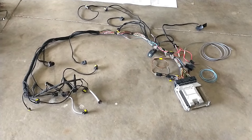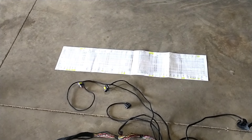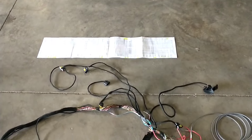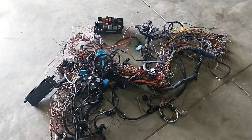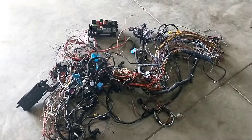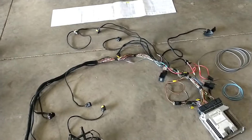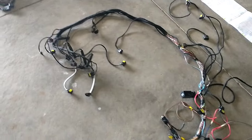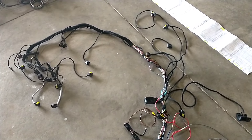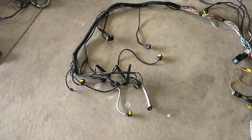I want to do an overview, but I really have to lay it out for you — you're going to have most of this junk right here and you're just going to have to go through the schematic one wire at a time to each sensor. Trace out every wire crossing through and verify you don't need it before you cut it. I bet I cut 60 wires out of here that were woven into these main sensors — time consuming, but honestly it wasn't terrible once I did that.